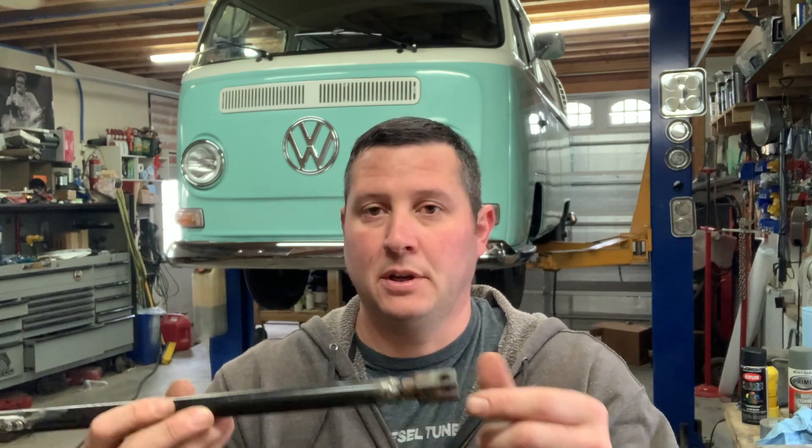Just to clarify: when I said I bottomed the nut out on the booster side, that's because I knew I was putting the nut on it to get it away from being bottomed out in case I needed to shorten it at all. I can obviously lengthen it, and I also have adjustment at the front end as well. Measure it up a couple times — I like to actually put things in place and mark them so I know they're right. It came out just how I wanted it to, and I'll get it put in the bus after I put a little paint on her.